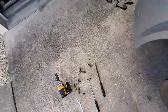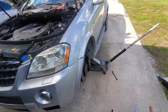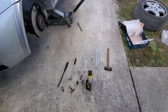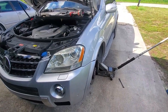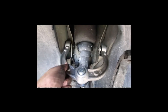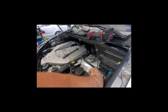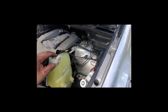Don't forget to tighten your nut on the under-hood side of the truck, then put the wheel back on and you're done. All in all this is probably taking me 40 minutes tops, including taking the wheel off which took about 10 minutes because these lug nuts keep getting stuck to the socket. If you have regular lug nuts and some talent, I don't see why you couldn't do this in about half an hour. Push the new arm in with a little force since the bushings are new, jiggle the bolt through, do the same for the other side, then come around, remove the reservoir, put the nuts on both bolts, and torque them down.